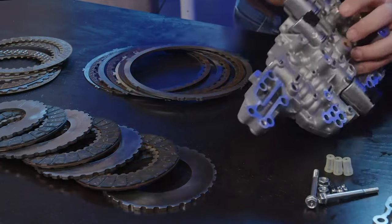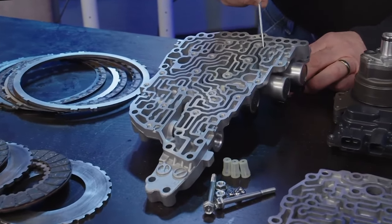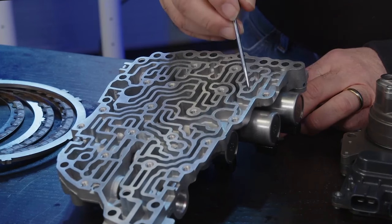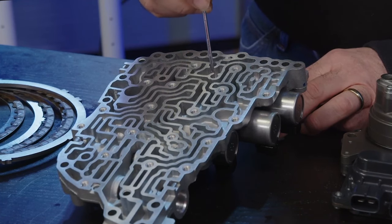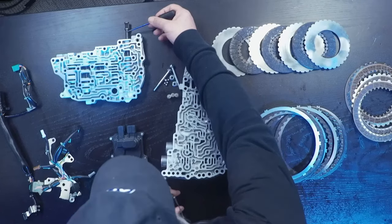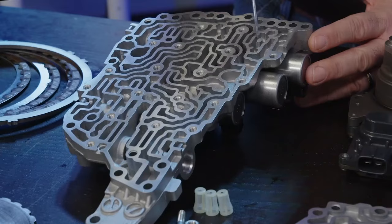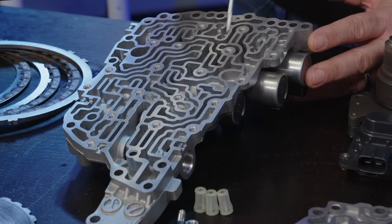Flipping this valve body around, you'll notice it's the same as the CVT8 valve body. These two check balls are used to control the forward clutch engagement and forward clutch release — one ball for engagement, one for release. The same applies to the two balls here for reverse. The select solenoid controls the oil going to the manual valve. If this solenoid malfunctions, you could have no engagement or delayed engagement, because they don't want the forward or reverse clutch to engage harshly, which would damage the pulley assembly called the variator.